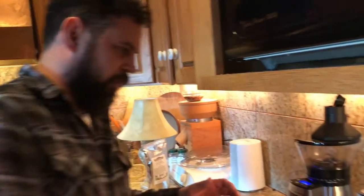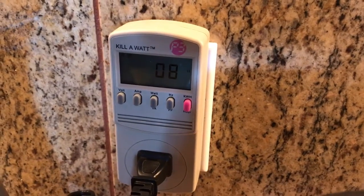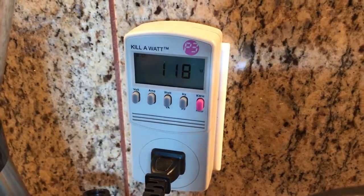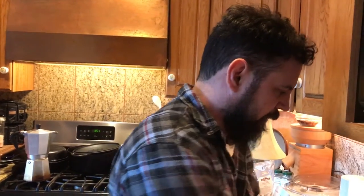This is something you definitely want to unplug. Now let's look at these appliances in use. The coffee grinder is drawing 8 watts at rest, and when I run it, it hits about 150 watts — actually pretty low. In a follow-on video I'm going to use the battery bank and talk about which appliances are appropriate to run on it and which ones you should avoid. So we'll keep the coffee grinder unplugged since it constantly draws power.